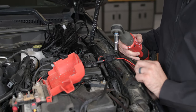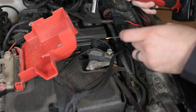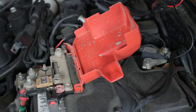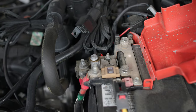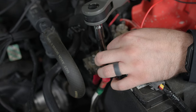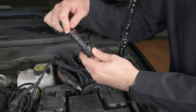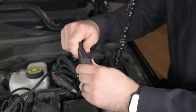We're going to connect our wiring harness to the truck's battery. Take a size 10 millimeter socket, back off the nut, slide over the terminal ring, and then tighten it back down. Do the same for the power side. Now take our IP68 connections, line up the tab on them, and use the lock collar to firmly connect them and make sure it's waterproof — go ahead and lock that down all the way.